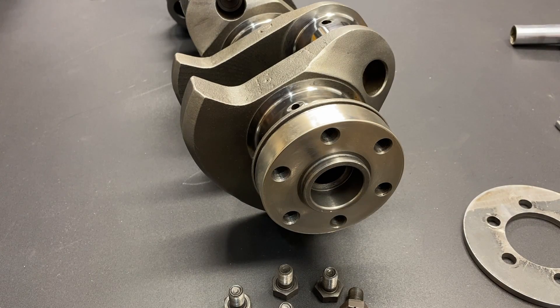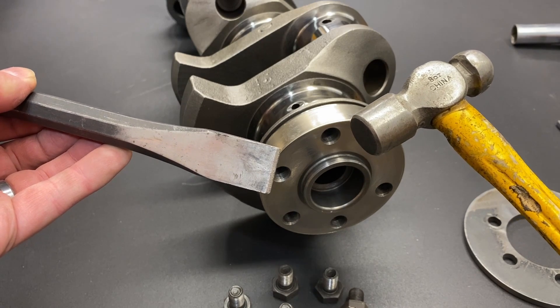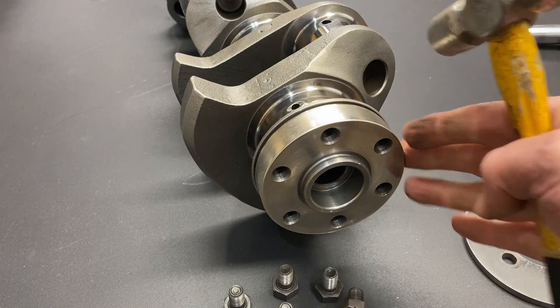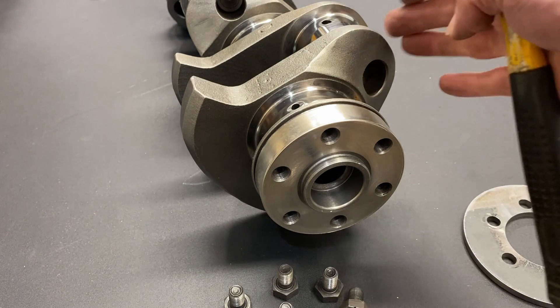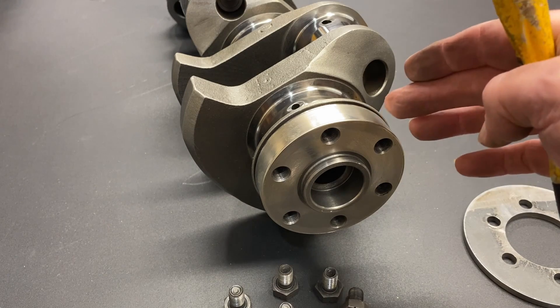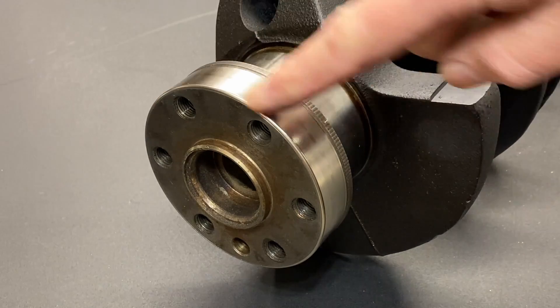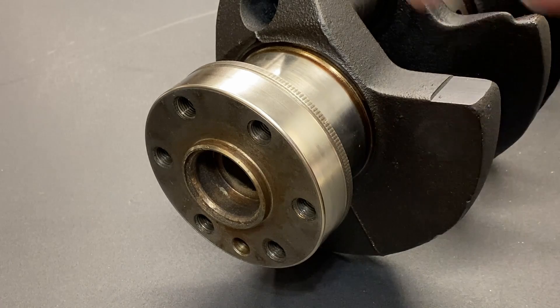So now, how do we take it off? Cold chisel and a hammer. And you've got to be thinking, this guy is going to damage his crankshaft. We're not going to remove this one — we're going to remove one off of the 351 crank that came in the block this is eventually going in. This crank is ready to go in, so there's no reason for me to remove this sleeve. But I'll still show you how. This is the 351 Windsor crankshaft that came out of the block I'm converting to the 393, and it already has a sleeve installed. There's nothing wrong with the sleeve — there's no reason to remove it other than to show you how to do it.